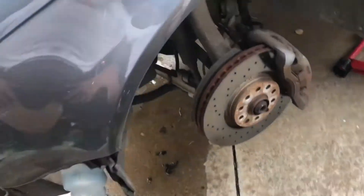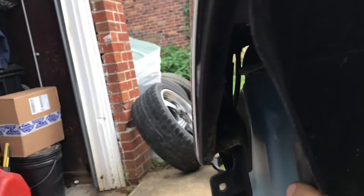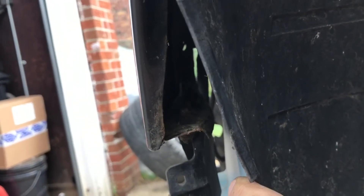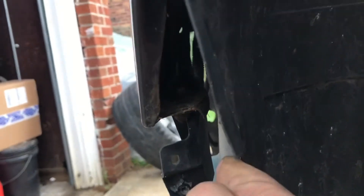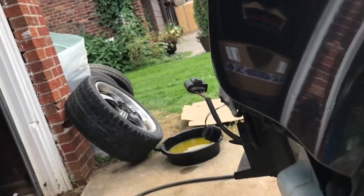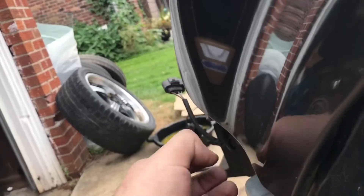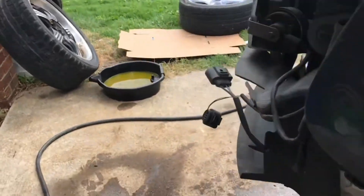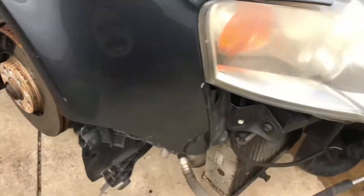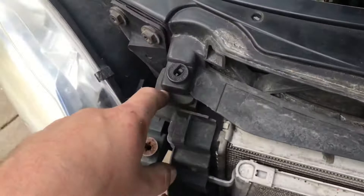Put the car up on jack stands and took the wheels off. I undid the screws on the inside of the fender well, and once you do that you just peel it over — there are studs right there with two 10-millimeter nuts. Reach back there with two long extensions, 12-inch ones, and zip those off. Then push the bumper forward while unsnapping right here, and the bumper will peel apart. Same thing on the other side.